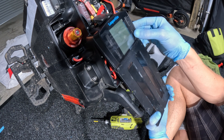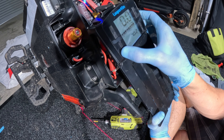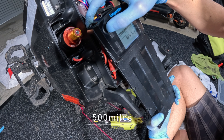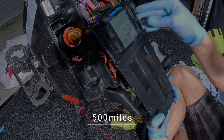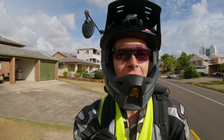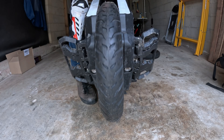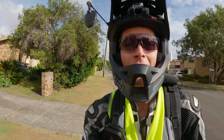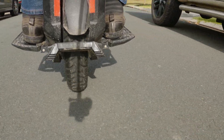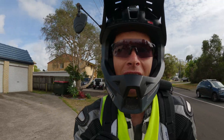Test power on — fingers crossed. Perfect. Let's check the total mileage — 831 kilometres. The agility is so huge, I can feel right away it's like the V11. But I definitely need to get that tyre seated — the wobbles are horrendous at any speed. I'm going real slow because I've got the pads off, and I'm going to try to change the tyre at the gas station to reseat the bead.